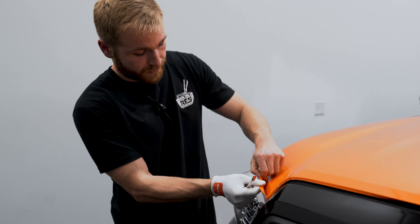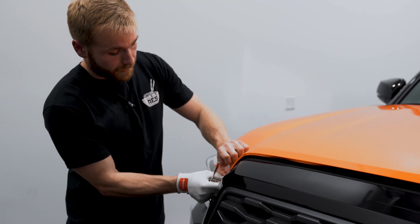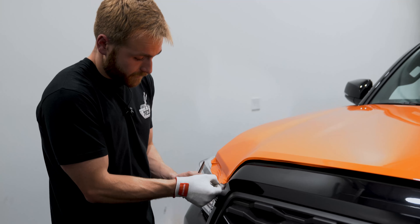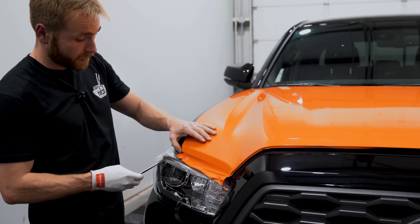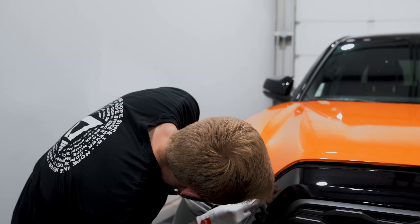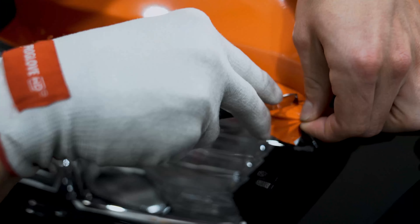Now that I have rolled all the corners, I'm going to go back and make sure all my edges on the sides are rolled just a little bit. You can lift the hood up and wrap it all the way around for full coverage. On the hood corners, we're going to heat those with the torch — that lets the film relax to its original state so there is no tension on the corners anymore. Once it cools down, put your knife on the back edge of the corner and slice just a little bit, making a U-shape out of your corner. That will give you coverage around the corner without so much extra that it causes bunching.